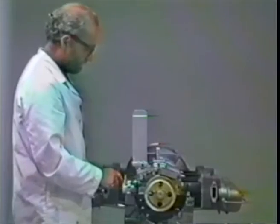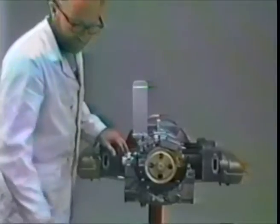Okay, you get the nuts snug, but don't over tighten them or you will break the insulator block. And then you have a nice new pump, cad plated parts on these screws and everything, and nice shiny aluminum. You can take hours trying to clean up an old one. And that's the pump. Next step, while we're here, is to put on the generator stand.